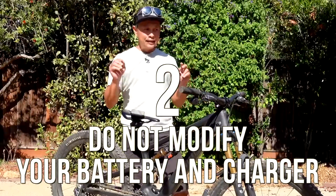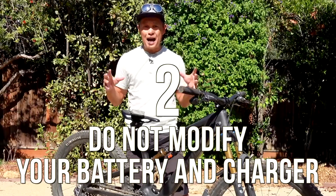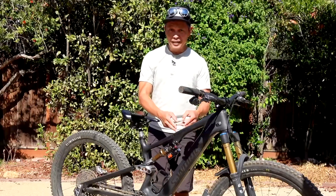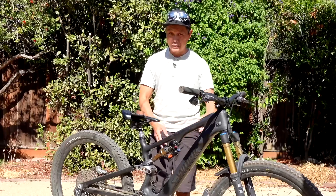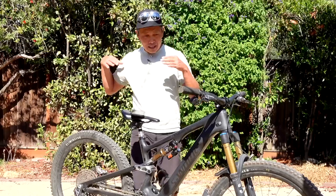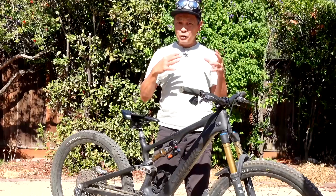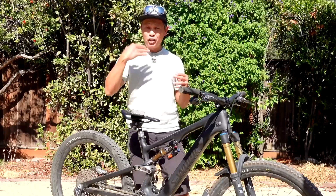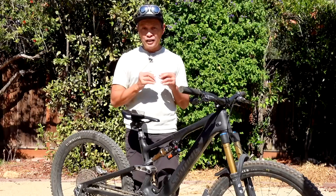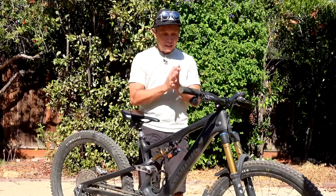Tip two — and this is why charging is so important — is that most lithium fires, 99% of them, happen during charging. The only other occurrence is a short circuit, and it's very hard to get a short circuit on these bikes because the wiring is quite secure. Charging is when the battery is getting to full capacity, and the thing with lithium is when it's full, the charger has to shut down. If it doesn't shut down, the cells will swell, get exposed to oxygen, and ignite in a fire you cannot stop.